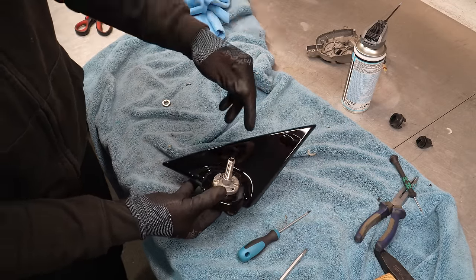There we go. Don't scratch the headlight. I just spent an hour and a half lining up all of the gaps between the bumper and the hood around the headlights. And I got this gap pretty good here. It was pretty massive before, and that's because this bumper is sagging. So when I push it up, it takes up that gap almost all the way. That being said, this bumper needs to be replaced. It's US spec, it's been replaced, it's been repaired before. So that needs to be done. But around the headlights, everything looks good. Like the line here, the bottom, and then this one as well. And then this here is nice and flush with the fender as well, so I'm quite happy with this. Here we go, correct kidney grills.